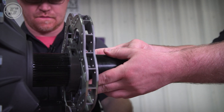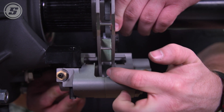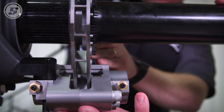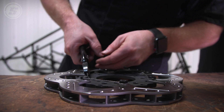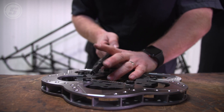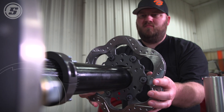We'll check alignment here. It'll fit on there, but as you can see the center of the rotor is not in the center of the caliper. Then we can go ahead and tighten up these bolts. We're going to put the safety wire in the hole here and do pairs of each one. Now we got them all safety wired on there and they're not gonna fall off.